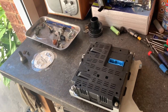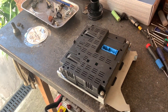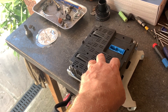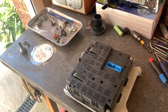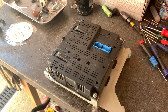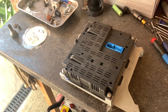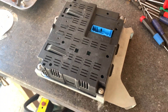I'm going to give it a bash and see if it's going to work. I've got to take all the back seats out again and take that panel off again. The only other thing I've found out since is that there are also two fuses that serve this. When I had a problem with a previous car that I sold, I changed the unit but it still didn't work. I've since found out there are two fuses on the BCM, which is under the parcel shelf on the passenger side. So if I put this in and it doesn't power up, I should check those fuses. Someone on one of the forums helpfully said there are two that serve it, so it's certainly worth a look.